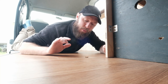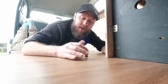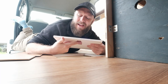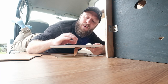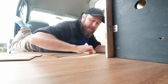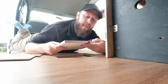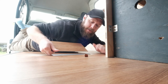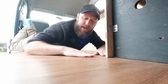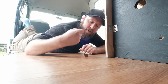For maintenance access to the fuel pump or water pump under the floor, I didn't want to block it off permanently. I solved it with a small leather tab through a gap in the flooring, so I can still lift that section when needed. I also drilled a small half-hole so I can insert a screw and pull the panel up if the tab alone isn't enough. Underneath is another layer of insulation, keeping everything sealed. It's a little obvious to look at but hides fairly well, and the leather handles the wear from repeated lifting.